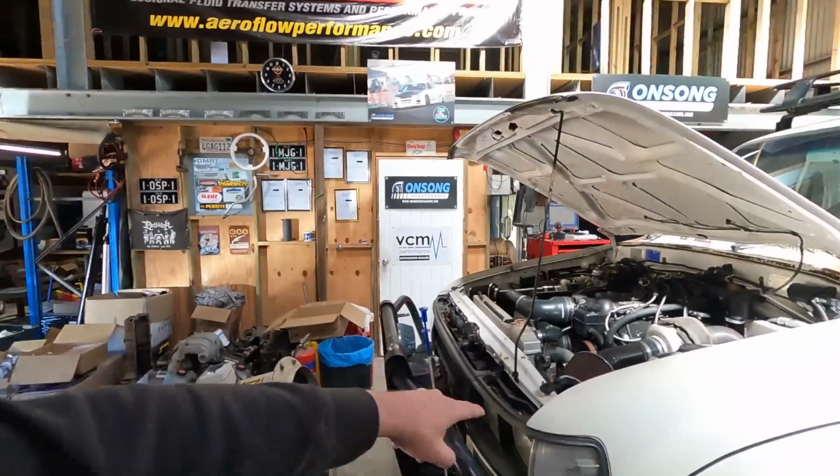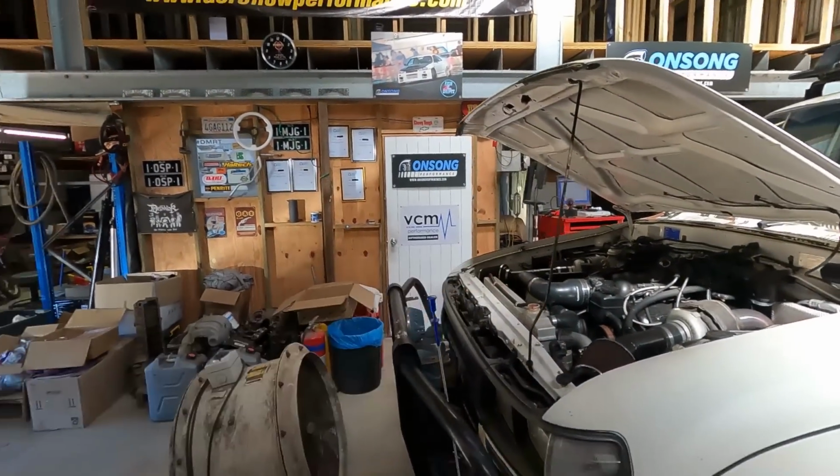The ECU reckons it's only seeing like 12.8 volts, but the alternator post and our posts over there in the engine bay both say like 14.7. So the alternator's charging, but for whatever reason, the ECU is only seeing 12.8. Rex is investigating that now, and the multimeter is doing some weird stuff. So it's another thing we're trying to figure out, what the hell's going on there.